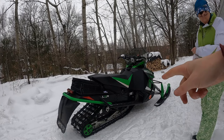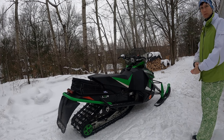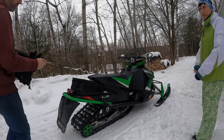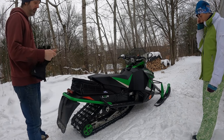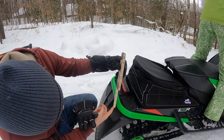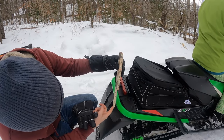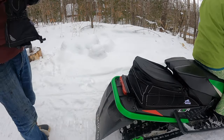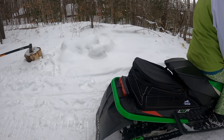All right, so all the pivot points have been greased on the skid, and I spun the spring all the way down. So let's see how far down this thing collapses when you sit on it now. Did you have a big breakfast? Okay, it collapsed about 2 inches. It seems a lot softer. Hopefully it's not too soft. Why don't you take it for a test ride and film your report coming back.